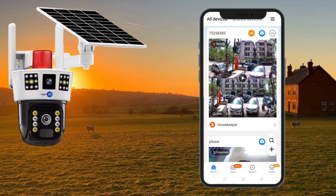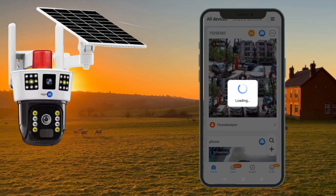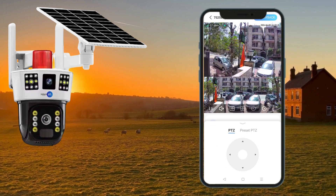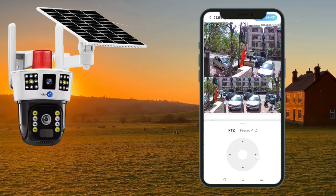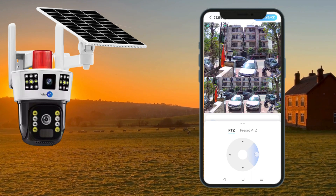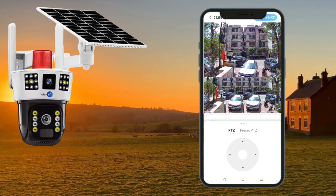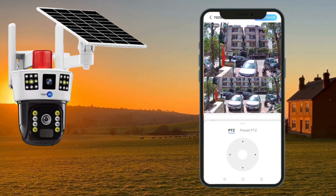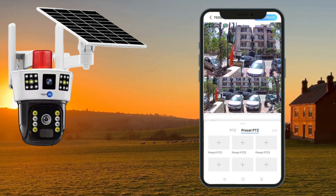Now let's quickly show you the other features of this camera. First, it is PTZ. When you're seeing the three views, one of the views is actually PTZ, so you can actually rotate that camera. This view can be rotated up to 300 degrees, and you can configure it very differently from static cameras. There is also a preset PTZ setting for auto surveillance.